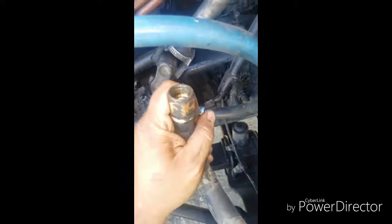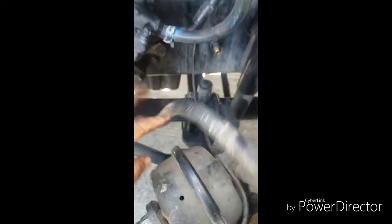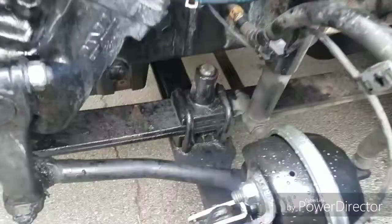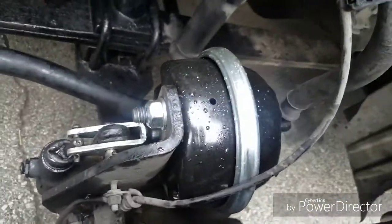There is no air, but if I push the brakes, air is probably going to come out from here. I already took the bolt from the bottom and I'm going to take this one out. This is the new brake chamber for the front.